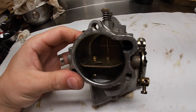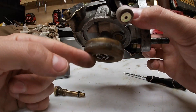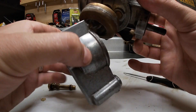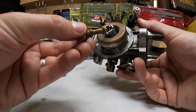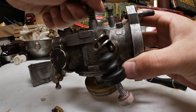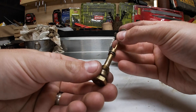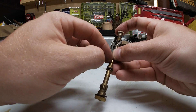So I popped the bowl off. For my mechanical friends — this has a brass float, old school technology. Every float now is obviously plastic. I took the bowl off, and this is your main jet — I unscrewed this, it came right out of the housing. Now if you can see in there where this main adjustment sits — this is everything you need to know, this is why I love simple carburetors. When this is in here, this is your jet setting.